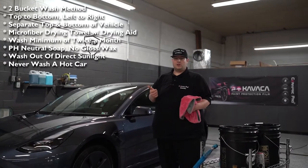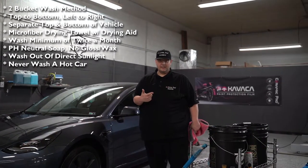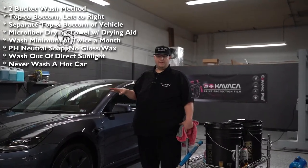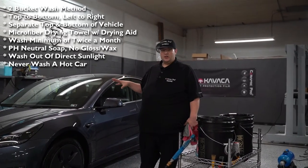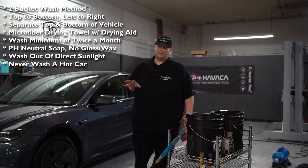You want to always make sure to use a pH neutral soap, nothing with heavy degreasers or waxes in it. Those things can, A, hurt the PPF and ceramic coatings, and then waxes and sealants can cause the coatings to behave very weirdly and not give you the hydrophobics that you're looking for.